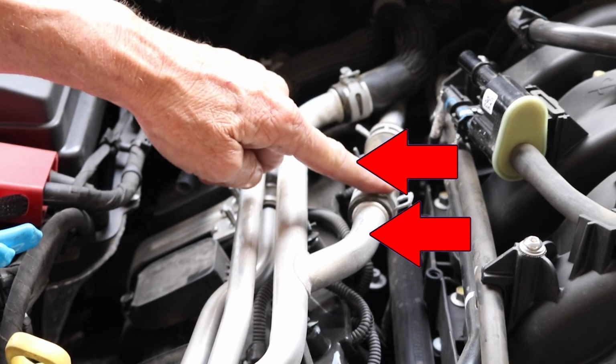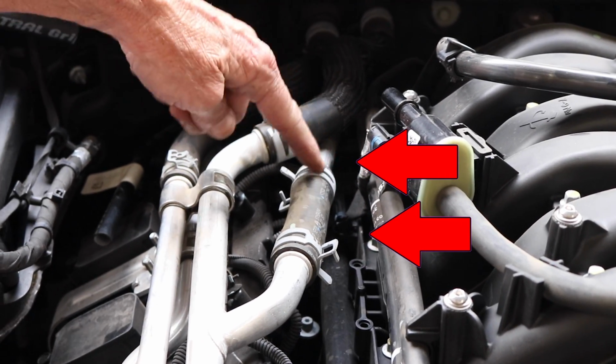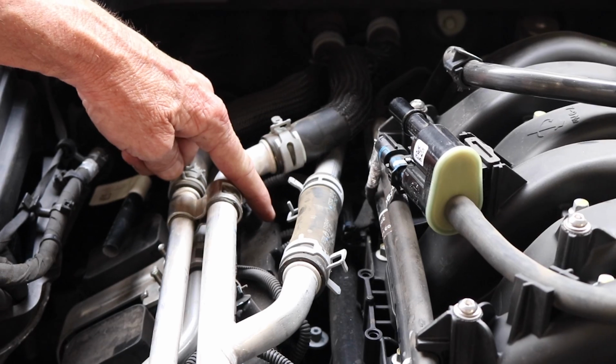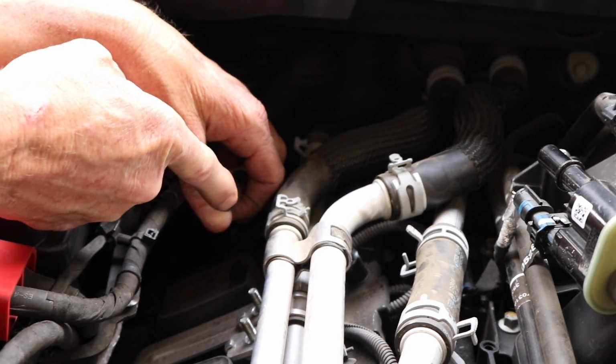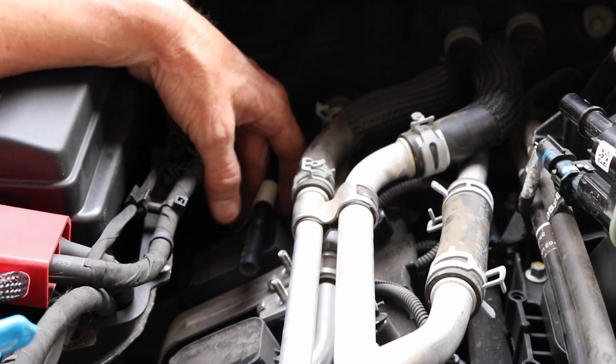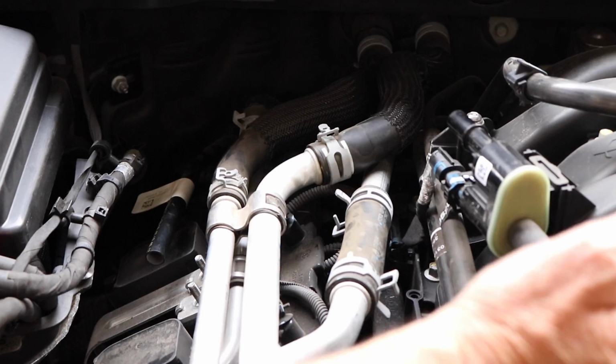Next, rotate the heater hose clamps holding the heater hoses so they are facing the passenger side of the car. Both air brackets need to be rotated to fit the hose. Remove your original hose from the vacuum line and cut the end on the left side so the remainder of the hose is in line with the back stud that you removed the nuts from.